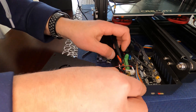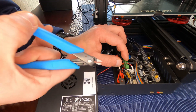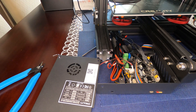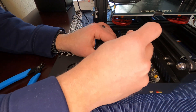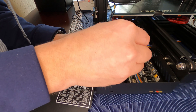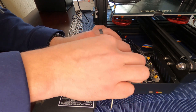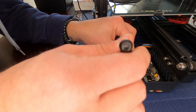I can confirm that's the right wire by seeing it move. We need to disconnect all the wiring that goes to this cable — there's another little cable tie to snip. Now you have the 24-volt wiring going to the hot end. You'll need a small screwdriver — one came with your original Creality kit, and the new extruder also comes with one. Note where the wires go: it's marked on the board, plus and minus, red being plus and black being minus.